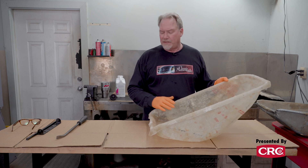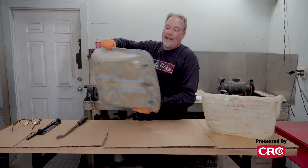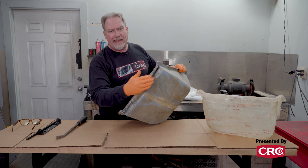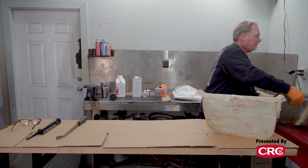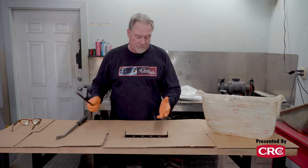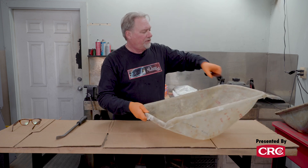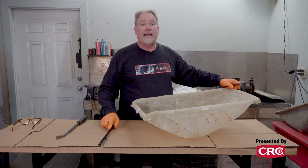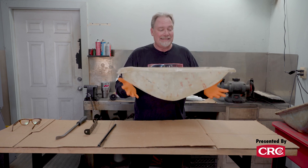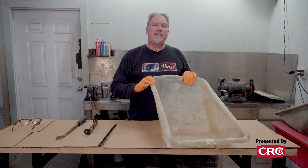There is some finish work we'll have to do. The other seat has got a seat bracket in the back that connects to the frame of the car, and then there's a threaded rod at the bottom that's been glassed into the old seat. I manufactured a copy of that bracket — it came out quite nice, took about an hour to weld up and fabricate. We will have to install these pieces into our finished seat. At this point, this is a very thin facsimile of a driver's seat, so we will need to add layers and thicken this up.